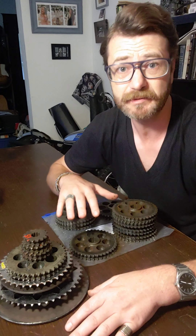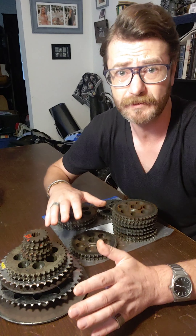The way this chain case works is there is an eccentric bearing inside of here. These are the tensioner bolts, and you loosen those up and you can create more tension on the chain or reduce tension. You don't want your chain too tight. Then when you tighten those bolts down and grease everything up, you've got a nice chain working properly in there.